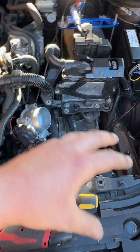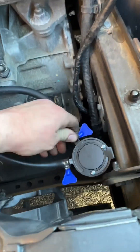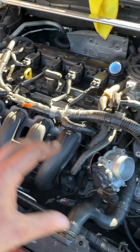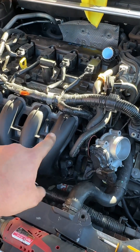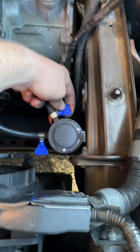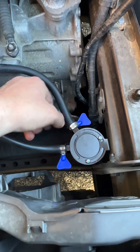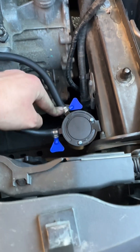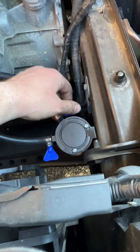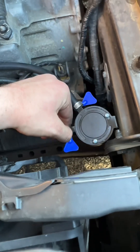Make sure all your seals are good - make sure you've got your seals on your fittings before you screw those in and tighten them down. And then get some good hose clamps. These can have a tendency to fall off, especially on the motor side where they're a little bit looser. Get some hose clamps that go in there, run everything before you put the intake manifold back on, tighten them down. Then you can pull your hoses over here and put some hose clamps on this side. Even if they're not going to help with the seal, they'll at least make sure they're not going to come off, because these are a flanged little male inlet tube on the top. I really like these ones that you don't need a tool for, in case I ever do need to pull this catch can out - all I've got to do is remove these two screws on the top and pull off these two hoses.